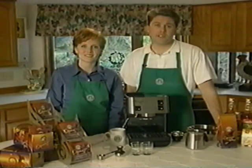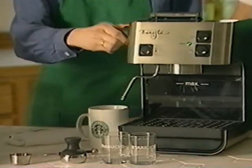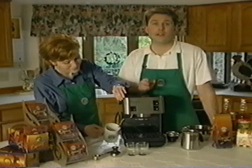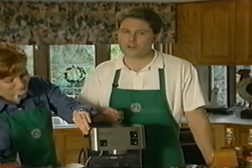Let's prime the machine. Turn the machine on and immediately open the steam knob to dispense about half a cup of water. What you are doing is flushing out the old water and introducing fresh water into the system. This will ensure that when you create your shot of espresso, it will be with fresh water, creating a better beverage. After dispensing about half a cup of water, turn off the water flow by closing the steam knob. Your machine is now primed.